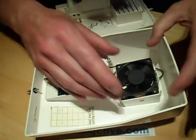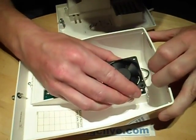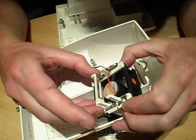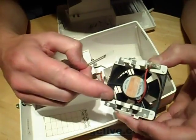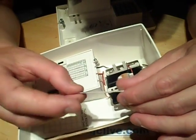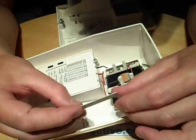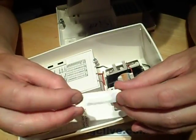Let's take a look at the ozone generator block first. It's supposed to just unclip — there we go. I immediately notice a loose connection. It's a little computer fan, 12V, 2.3W, and it's got this little ceramic plate which slides out. The way it slides in, it's got a connection on each side, so it applies high voltage, high frequency across this. The end bits act as the connections, and where they overlap is where the corona is generated through capacitive coupling — the ceramic acts as the dielectric.